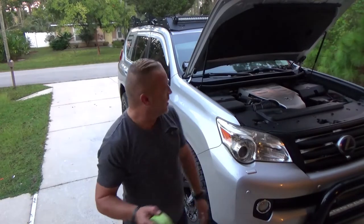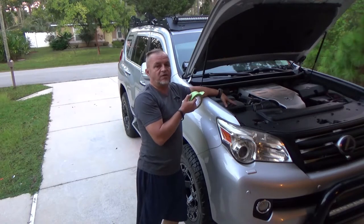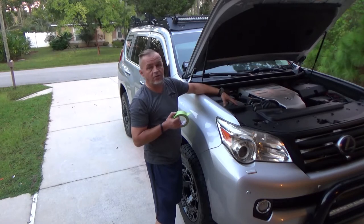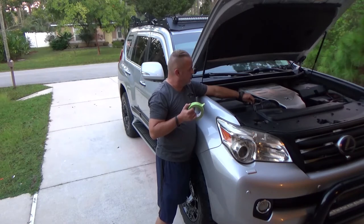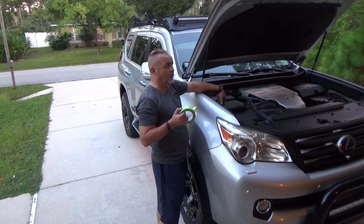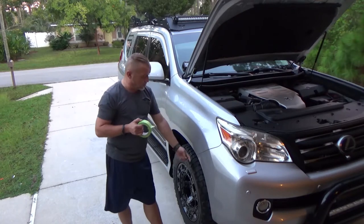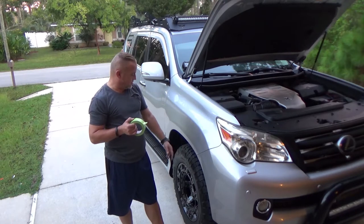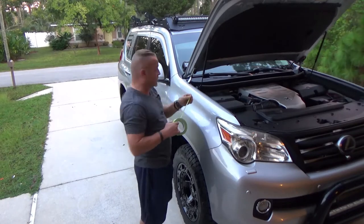That will definitely help. There's going to be some components that you have to take out, but I'm going to get you guys through that. You got to take the whole entire airbox out, filter and all. You don't have to disconnect everything that way, but from this flange, this piece got to go, because you got to dig in and unscrew and take the box out, because you got to do a small modification on this box. And also I got to take my fender liner, which according to Land Cruiser videos, is a pain in the ass. But anyway, let's go do this marking thing.